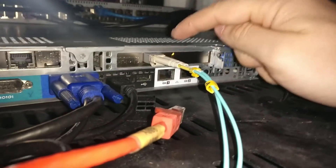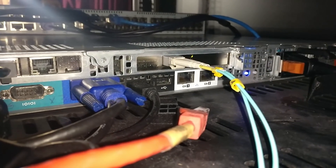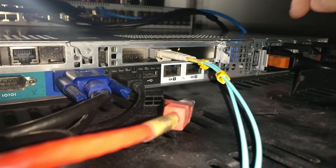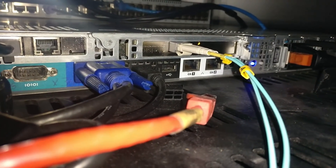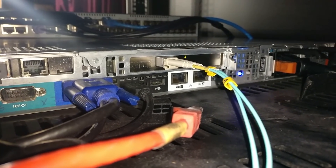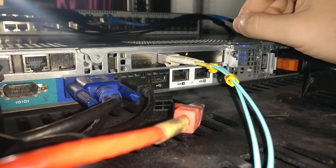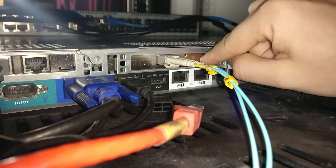I had a little bit of trouble with this card, because one of the things it does when it boots and loads its driver is check its firmware against the driver — the driver itself has firmware for the newer version of the card. Unfortunately, these older cards specifically in PFSense — I didn't test them with FreeNAS so I can't say BSD in general — but PFSense doesn't have the controller software to update these older generation cards.